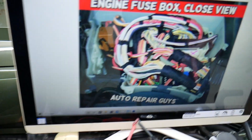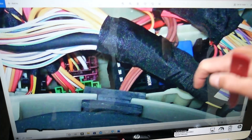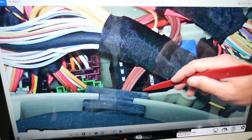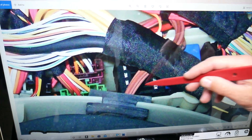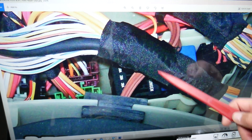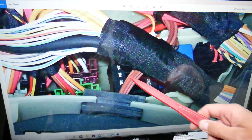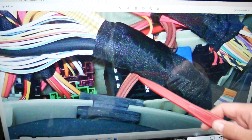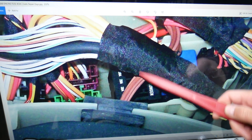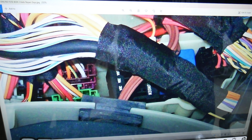The fuse you need to check — come look at this. You're looking for a fuse box that consists of five fuses, integrated into one fuse box. It could be on the left, the right side, up or down, depending on the model year and engine configuration. Remove the cap and you have five fuses. The fuse you need to check is the second fuse. But since you're already there, check all five just in case another one has burned and you'd have to do the work again.